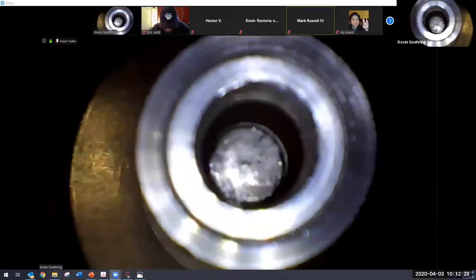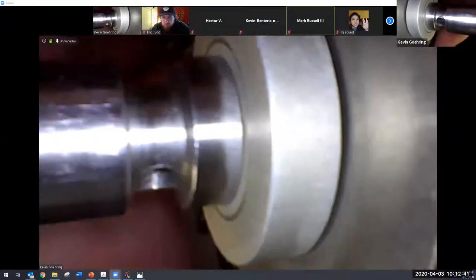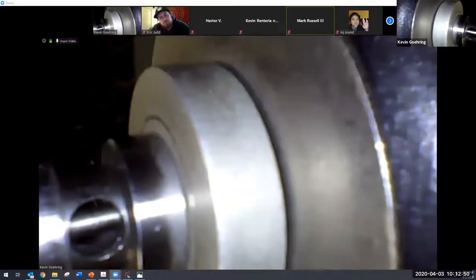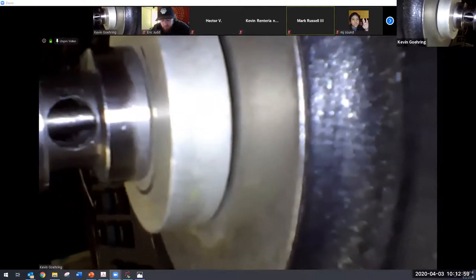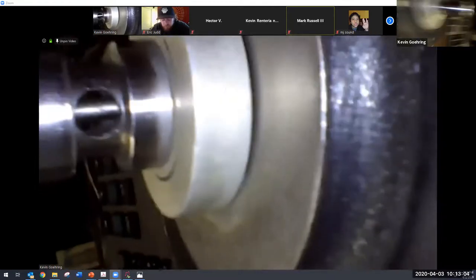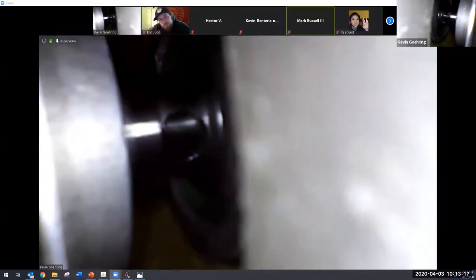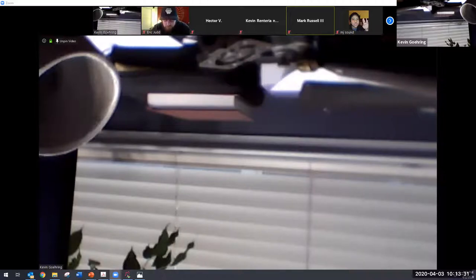If I look down in there, fuel is going to flow into these holes on the side. Let me hold this and turn — there we go, those holes. And down there you can see something inside that hole — that's the poppet inside the poppet. Fuel is going to enter through that hole, build up pressure around the diaphragm, the diaphragm lifts up, and then fuel flows into those holes. You'll have to tell me if switching cameras is obnoxious and I'll stop.